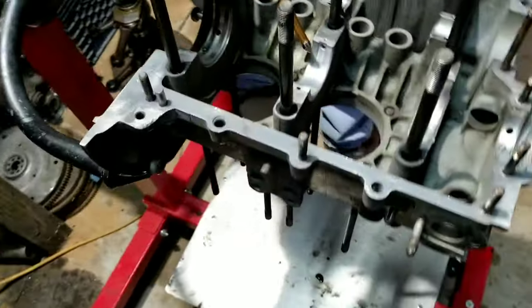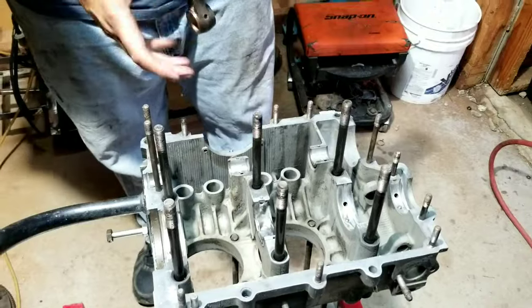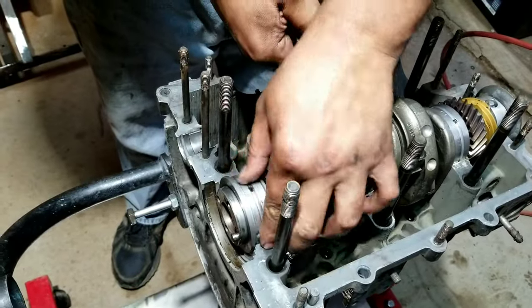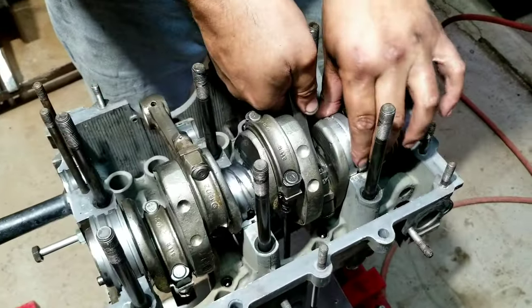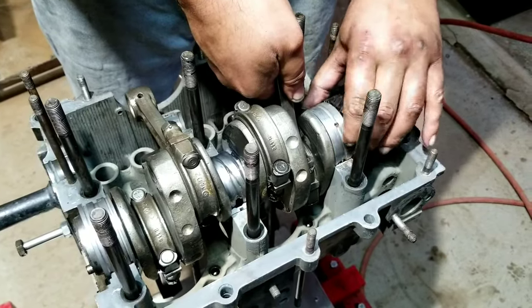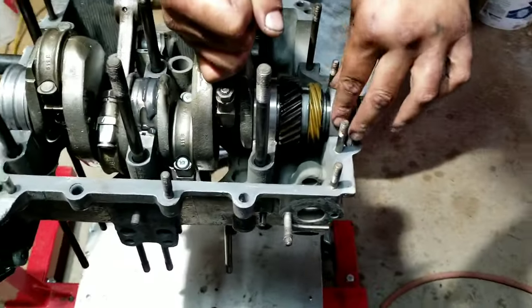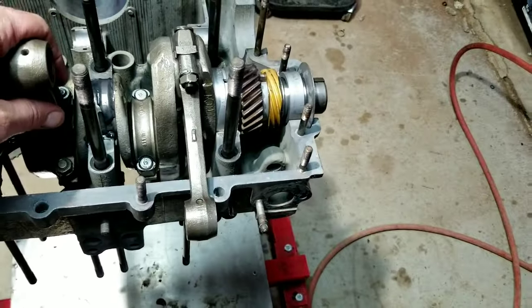We got the cam bearings and the crank bearings in. Of course, the cam bearings are used. How about that? Man, that's really being cheap. Part. All right, so let's drop this baby in. We got the bearings lined up. And just going to spin them around this time, just so you can do it any way you want. Spin around till it drops. Spin that one around till it pops in place. Sometimes you mark the tops of them so it's easier. We didn't feel like it on this one. Now we're doing everything a little bit different, just because there's a lot of different ways you can do it, and if we did everything the same, then somebody might not be able to relate to that. It's kind of to help everyone.